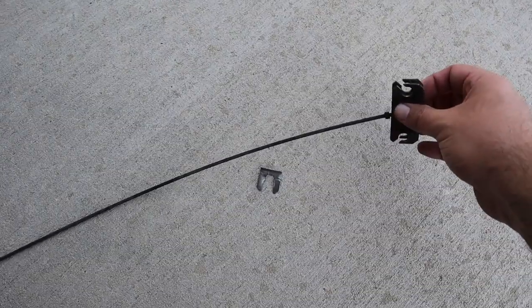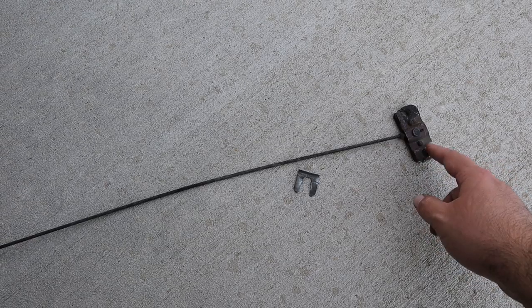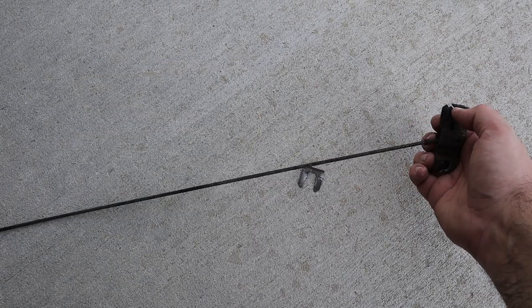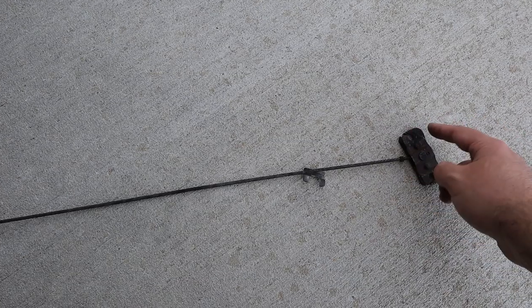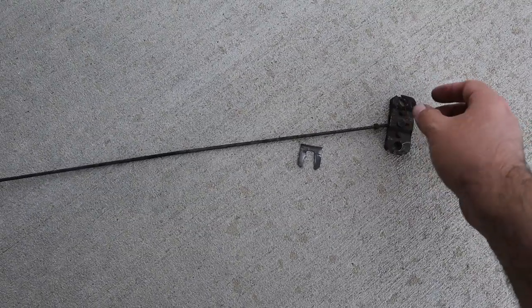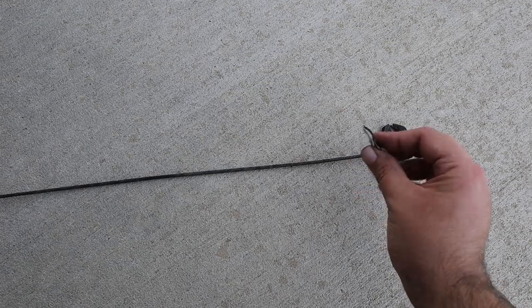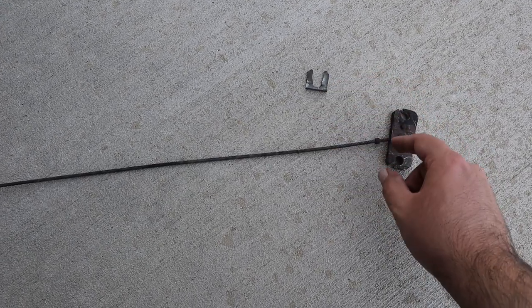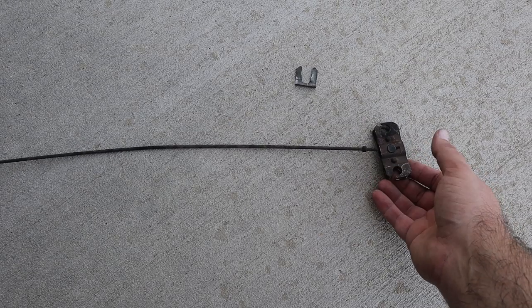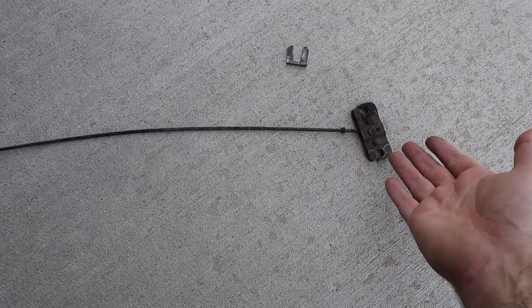This is the piece you're trying to take off. Each end of the cables that split off to the left and right rear brakes just has a drum where that cable goes into. Your goal is to slide the cable back out through this — you have to rotate the cable about 120 degrees in order to slide that off. What I did was pull this clip which is right next to it; you'll see where the two cables sit in a bracket. I popped this clip out, which gave enough room to slide the right-hand cable out, then I could rotate it with a screwdriver, my fingers, and long-reach pliers.